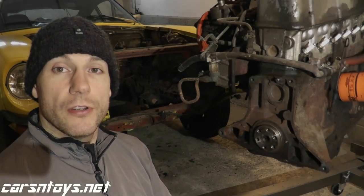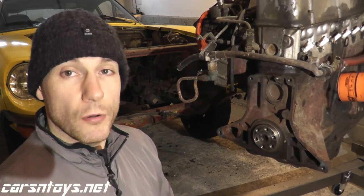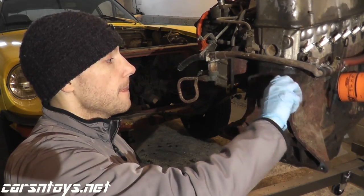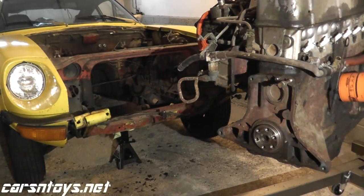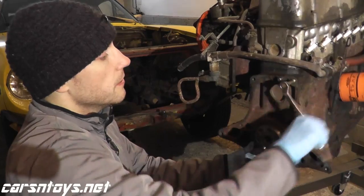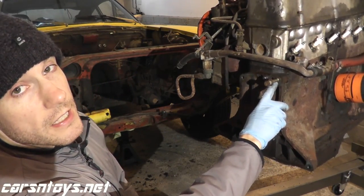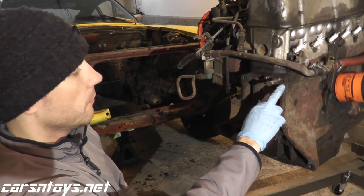The best thing you can really do is just take the transmission mounting bolts. In this case we had four bolts holding the transmission to the rear of the motor. What I tend to do is just thread the bolt all the way down. Let me just grab a wrench real quick and tighten it down. Now, what I'm going to do is mark that just to get an idea on the length — or in other words, how much thread is actually in the block right now.